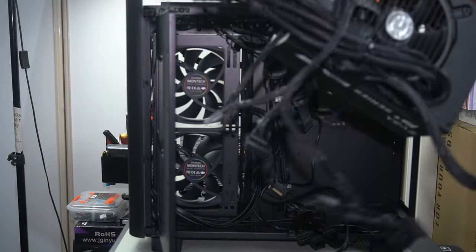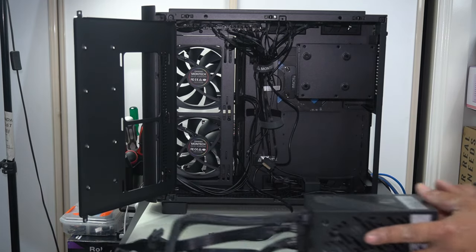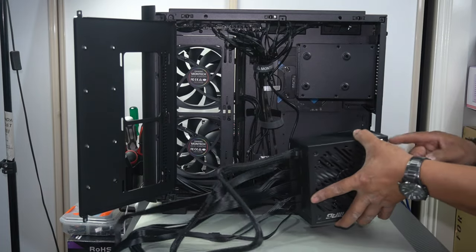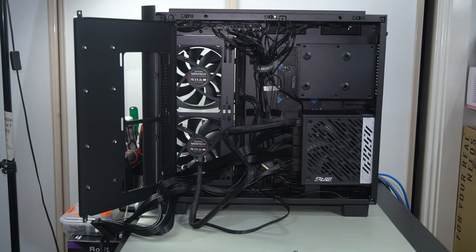Just like that, our power supply is already out. We'll peel this off first because you're meant to peel it off. Always have your fan facing outwards. Make sure your power supply sits on the bracket here — that's to hold it up. Line up your power supply, push it in, and then fasten the four screws.